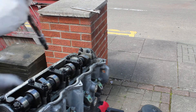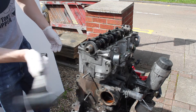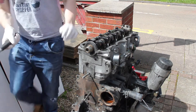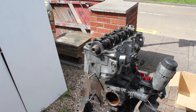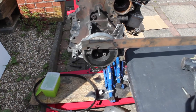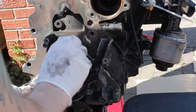With the rest of the engine there would be some attention needed on the crank. When the oil pump failed we ended up jump starting it with two batteries to crank over the engine, and I think that ended up slipping a bearing when it did turn over. We'll see on the oil pump in a minute that the chain got stuck — that's the reason it all failed. I think one of the links just seized up, which meant everything seized. If at the time we had stopped, stripped the engine and changed the oil pump it would have been okay. Now the crank needs regrinding. The pistons look fine — no lumps of metal in. This is a special piece of metal we welded onto the crank so we can undo it, which ended up being quite a handy tool. Crank off.